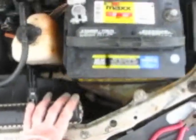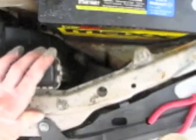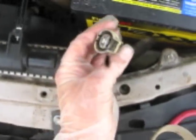On the side of the radiator, by the battery, you'll see a little electric cord. You want to disconnect that, or else you're going to pull it apart when you take the radiator out. There's one right here — it just looks like this, and it'll pull apart. You just press on it and then pull. Easy.